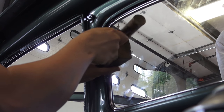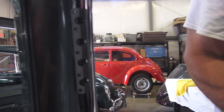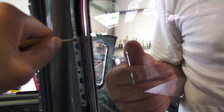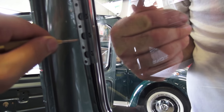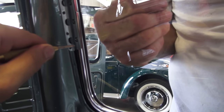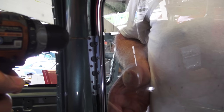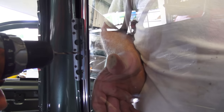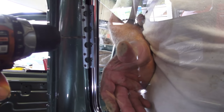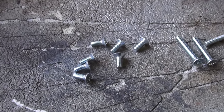I get a block of wood and a hammer and hammer that hinge as close as it can be to the lip on the window opening. Then I get my starter punch and make a dimple into the metal — press and it clicks — which seats the drill bit properly without it wandering. Then I get my drill bit and start drilling the holes. Keep the window in place as a guide; it also protects the body on the outside. I've drilled through before and slipped and scratched the body, so keeping the window in place is a good idea.